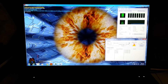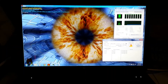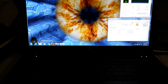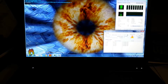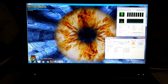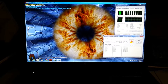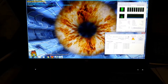Good morning. This will be just a quick overview of the HP ZBook 17. I'm doing a quick burn-in test to go over its specs and performance. We had a group of Lenovo laptops that had a problem and couldn't pass a simple burn-in test — they would crash, overheat, and weren't reliable. So with each laptop, before I send it out, I get the user to remote into it, configure it how they want, and then I do a burn-in test with their configuration, so I know it will be a reliable machine.